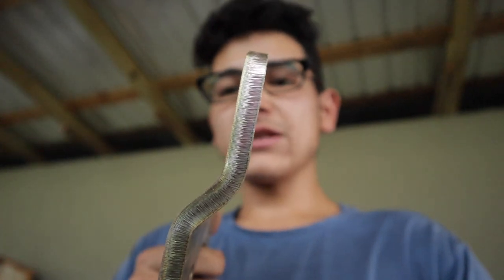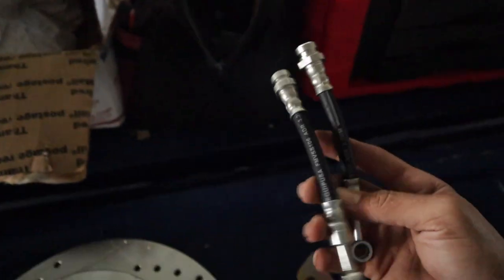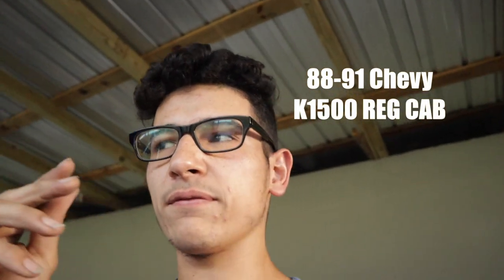For the hubs I need to replace the seals once I take it out. The kit is supposed to come with bolts but mine didn't, so I need to buy some. That bracket is about half an inch thick, so I need a bolt about half an inch longer than stock to compensate. The kit includes two brake lines and calipers — those are for a 1980s–1990s Chevy pickup truck, and so are the rotors. Long story short, this kit is from a Chevy pickup and should be a direct bolt-on onto the Toyota pickup, with this bracket and some modifications.